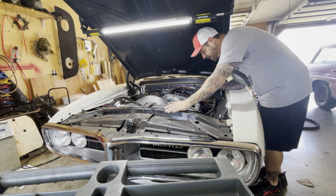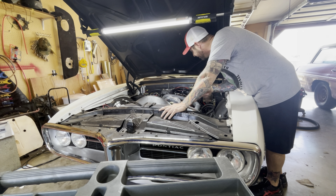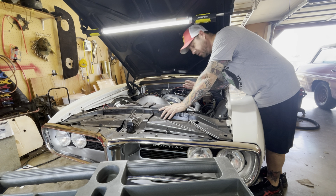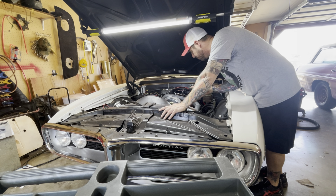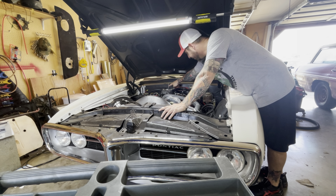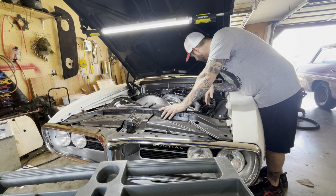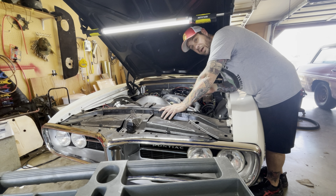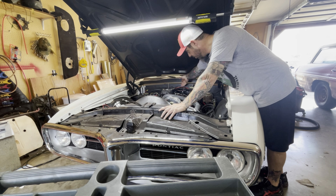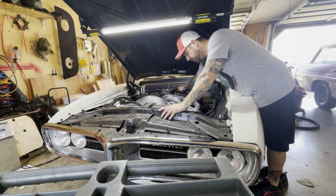Now we're going to get in here and start cutting zip ties. The one big thing I have to do is find a white wire that's somewhere in this main harness that I tucked up out of the way originally — that's going to be my points output running to the HyperSpark box. I'm going to start unclipping all this stuff, and after we plug everything in we'll tuck it back up against the firewall again. We'll probably fast-forward through some of this. Then we're going to pull our old distributor out.